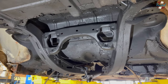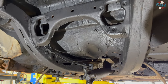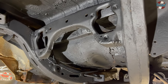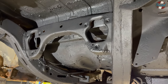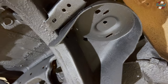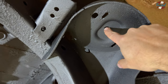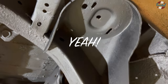We hit the frame with a wire wheel. There are some rust issues that are going to be addressed by the next place that has this thing, so we didn't want to go too crazy with undercoating and make more work for them — but we wanted to make it a little easier to touch up the undercoating without having to take the suspension back apart. We made sure to hit all the frame rails, cross members, and the more solid sections above those areas. As far as the upper spring plates, there's a half-inch bolt you take off. We dropped that out of the way and drilled the hole out to a half-inch diameter so the all-thread for our bag bracket can go up through there. We did that on both sides.